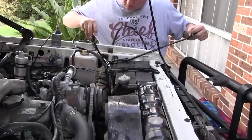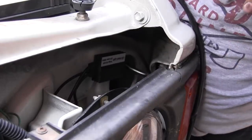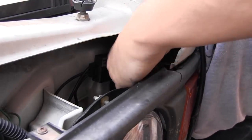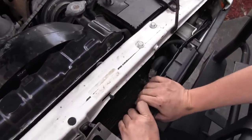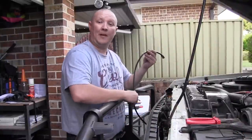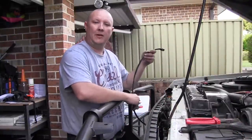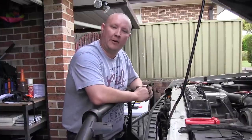Now we need to run the other two insulated wires that are terminated with waterproof ends to the position that the lights themselves are mounted. It is important to take your time with this and route the cables in such a way that they are well away from sharp edges and anything that gets very hot such as the radiator. We've got a fair bit of slack left over on the driver side and it's important that we manage this correctly — we need to keep it away from the heat source, which in our case is the radiator up front.